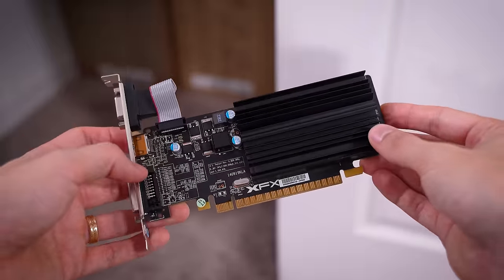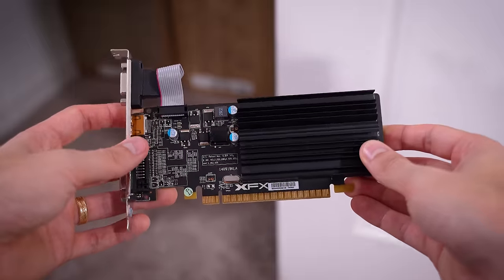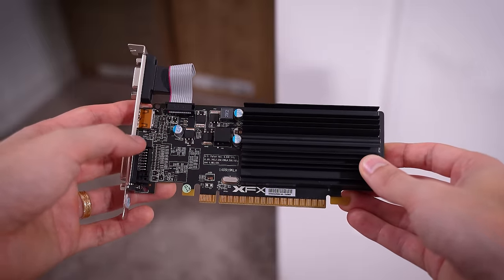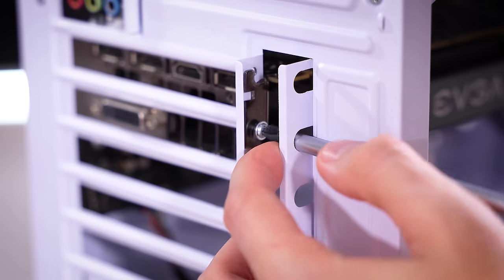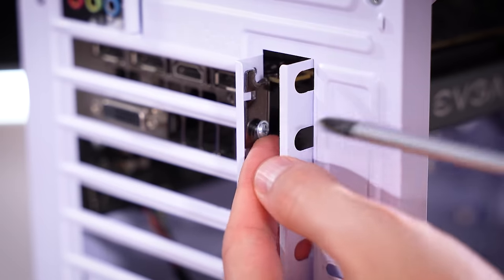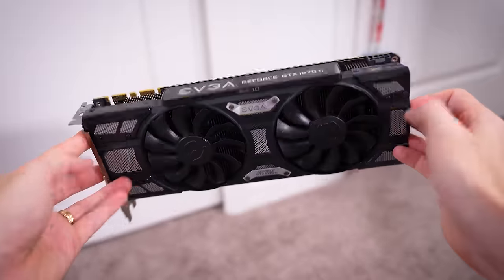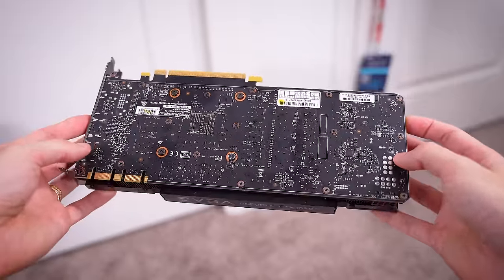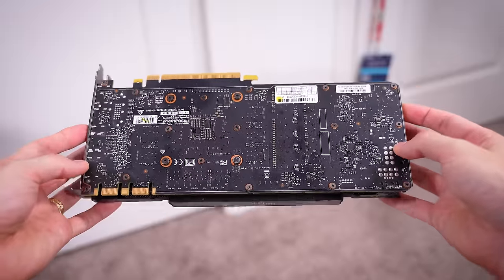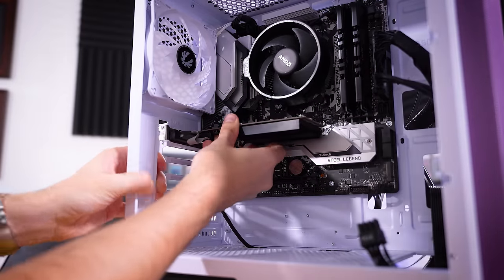So it's time to use our trusty XFX graphics card — this we know works. It doesn't require supplemental power and should tell us right away whether or not the 1070 Ti works. Also, these are not the correct screws to be using back here. Out she comes. We'll do a quick visual inspection — a bit dirty, yes, but from what we can see, nothing super alarming, nothing blown, nothing burned.